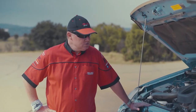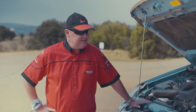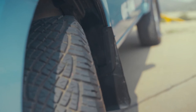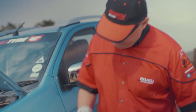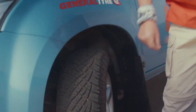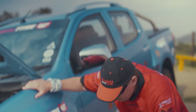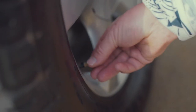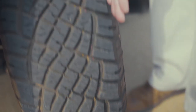Why are tires so important on any vehicle, whether it's on-road or off-road? Because at the end of the day, it's the point where the vehicle actually touches the road. The first thing you want to check is that the tire is wearing evenly right across the entire width. You want to check both sides of the sidewall, check that the tire has got a valve cap, and also check that you have the correct tire tread wear depth.